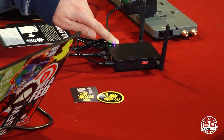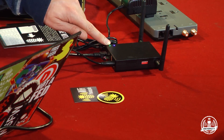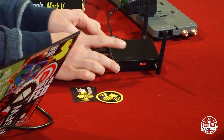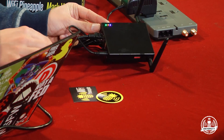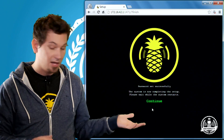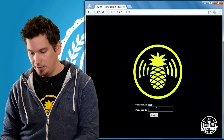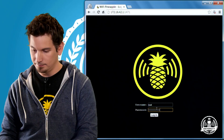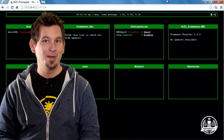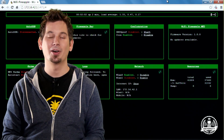We can see we are in fact rebooting — we have our blinking blue LED to indicate that and our solid green to indicate that we have power. After completing the boot, we have our amber LED to indicate that we're connected via the Ethernet cable. Looking back at the web browser, all I have to do is click Continue and give it the password I've provided. And there we go — logged in for the first time and ready to start having so much fun with the Wi-Fi Pineapple.